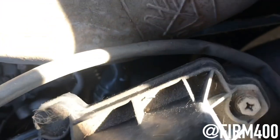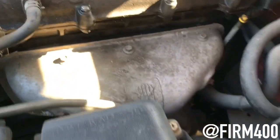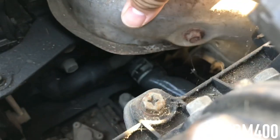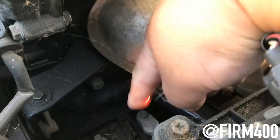Down here, over here, I noticed we had a leak from the coolant hoses. I looked up some videos and it looks like the O-ring right under this heat shield — there's a hose, I think it's right here. The heater hose return O-ring — I believe that's what it's called. I'm going to have to change that. We have to remove the heat shield to get to it.